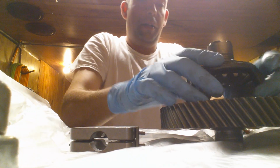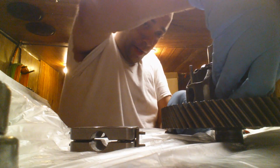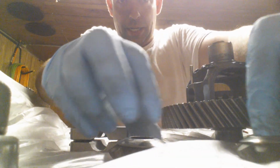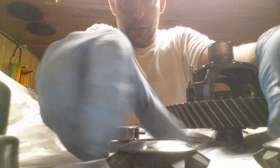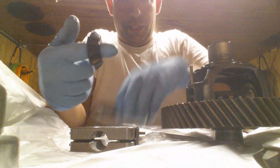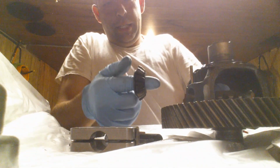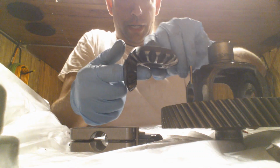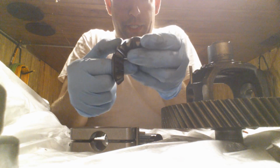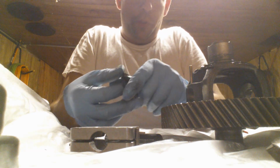This is the trick. This is already in my other transmission that I built for the car that I'm currently driving. Okay, so these are the gears that sit on either side, and they ride with the pin through it here, across the center. Here's your pin. And these gears sit inside and interlock on top. And the LSD locks everything tighter to where they have to carry each other for the most part.